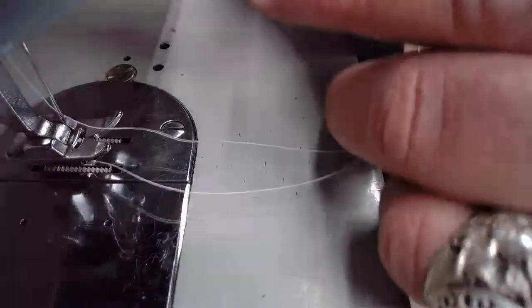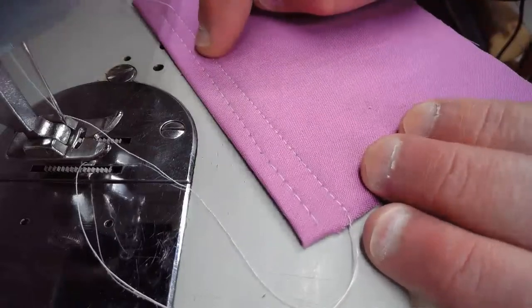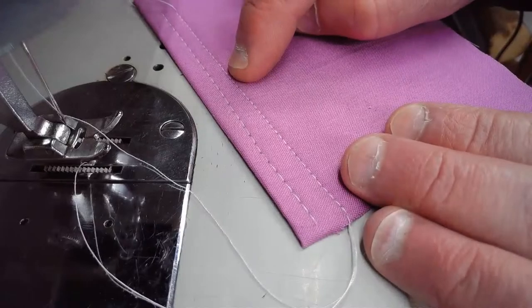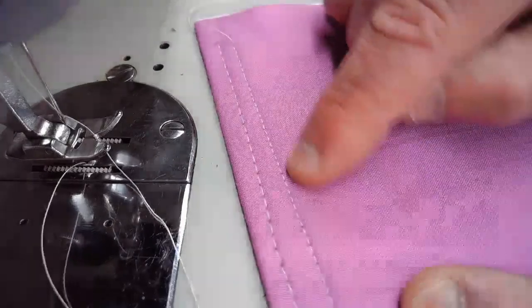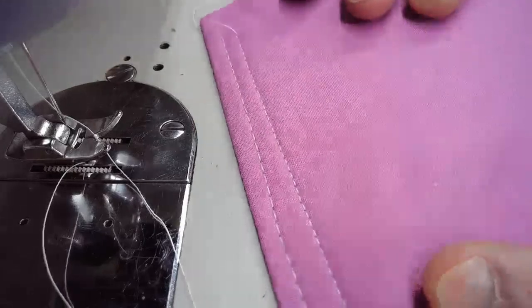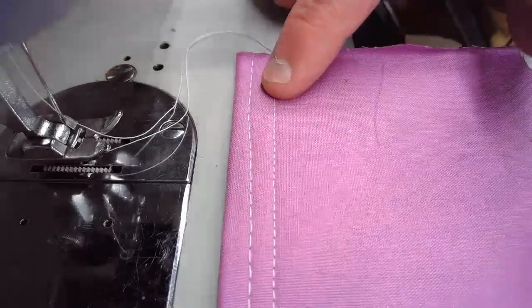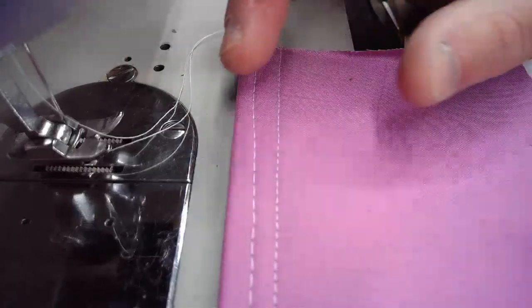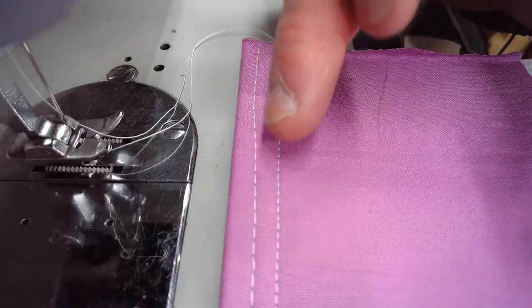Beautiful stitching. Wait till you see these. I'm almost seeing a slight stubbiness with the top stitch, which could tell us that our bobbin case is turned up a little bit too high. Again, if you look at the top stitch on this shorter stitch, and then we turn it around and look at the lock stitch, I'm kind of spinning it around. If the lock stitch has a little bit better presentation, it looks fuller, it looks more robust, then that's telling you that bobbin case is pulling down a little bit too hard.